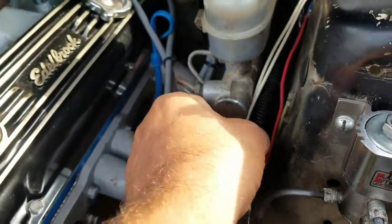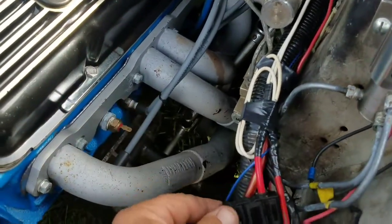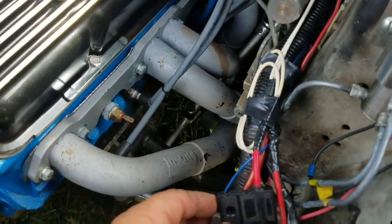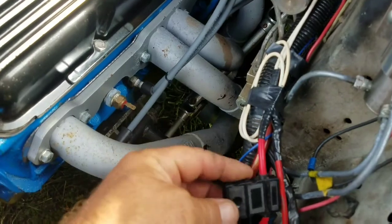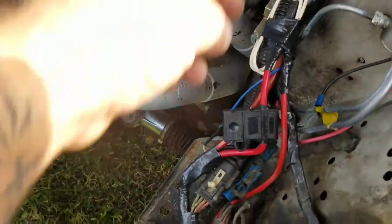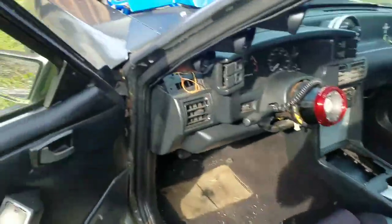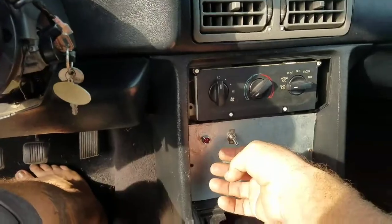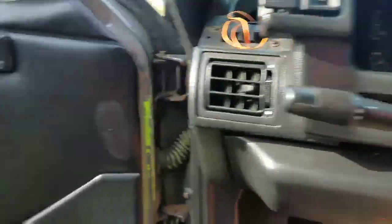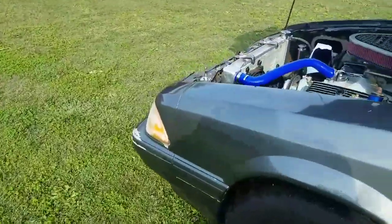I did use both white but it's the only thick wire I had — I didn't want to use too thin wire, it'll just get hot and catch on fire. There's a fuse link right there coming from my power up into here, into the cab, back out. This one runs back to the fans. It was set to come on at 160 but it kept messing up.